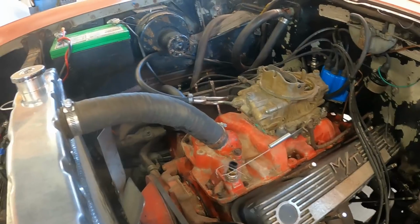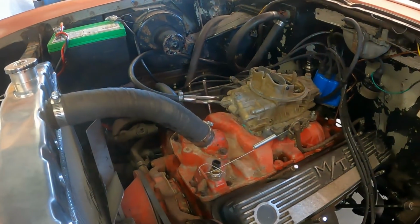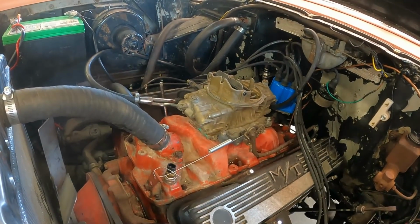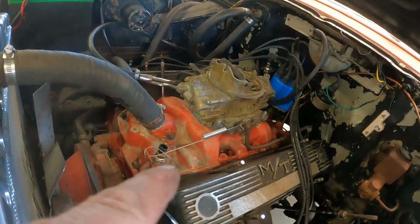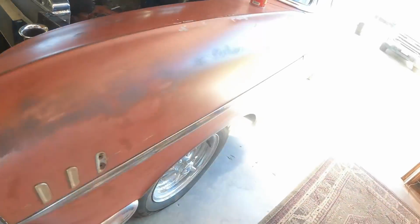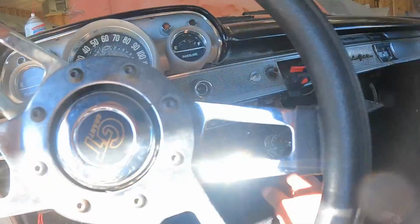So I took it back off and I put the old squirter diaphragm out of that carburetor in it, put it back on. It still wouldn't squirt. I actually have a rebuild kit on hand for this because that's what I was thinking about doing before I found the other carburetor. So I took just the squirter out of the rebuild kit, put the new squirter in, you know, the little diaphragm down here that makes it squirt when you step on the gas. And by golly, it's freaking 3 o'clock. I've been out here messing around all day.